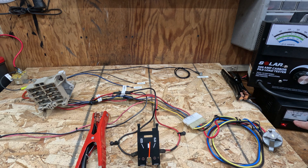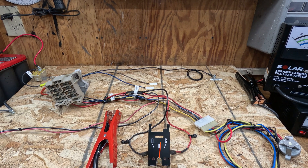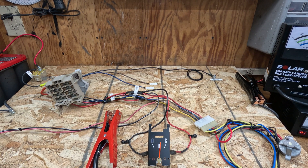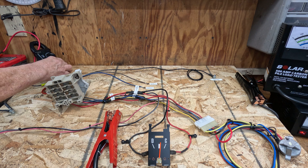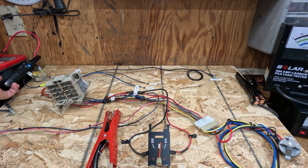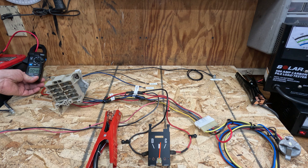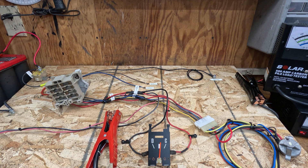Ignition powering up — the power supply will simulate engine running. We're seeing looks like maybe four or five amps of current. The ammeter in the dash is also showing a charge current. The battery we're using today is known bad — it's got a bad cell or something, doesn't want to hold a charge, and it'll sit here and draw five amps of current indefinitely. It's on the bench because the battery really has nothing to do with what we're going to show you.